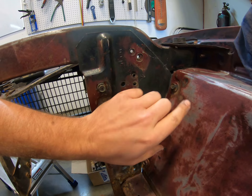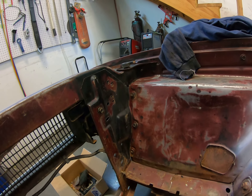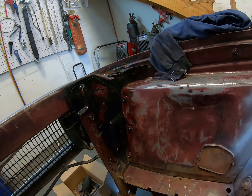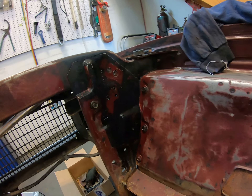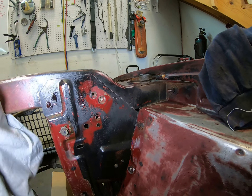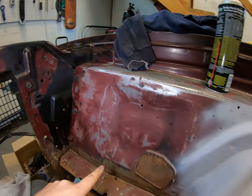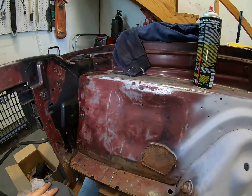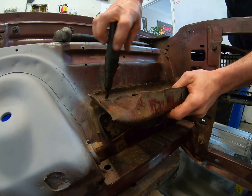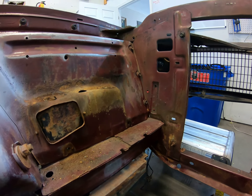Same video, new day. As you can see, Matt did great work in the trunk — it's looking really good. I've been up here working on the firewall — got it primed and it's looking really good. It was all mainly covered in black paint that somebody else had painted before. We want to paint the engine bay the original color of this car. What I've been doing to remove that black paint is taking some O'Reilly's brake cleaner, spraying it on a little bit at a time, letting it sit for a few moments — it chemically removes it. You can see it starting to bubble up, then you just wipe it right off. I'm going to finish up this little corner, scuff it, and get it all ready for prime.